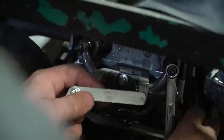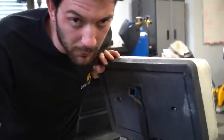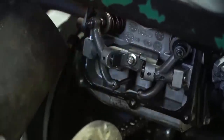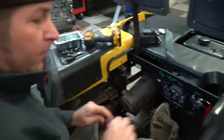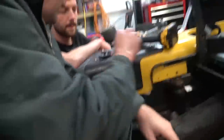On the loose side. And what do you have there? This is the 5. Okay. And the intake calls for 4 to 6 thousandths valve lash. So we're going to go for 5 thousandths. All right, dude. There it is. Perfect. They're both good. So what do you think? They were like 1 or 2 thousandths too loose? No, they were more than that.